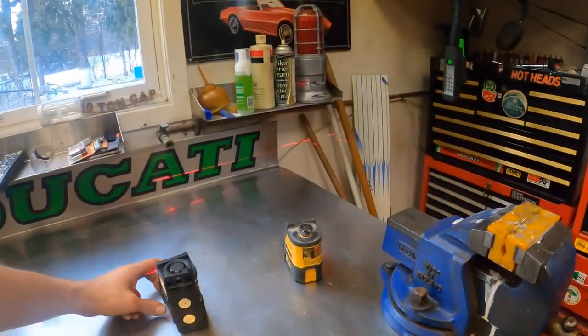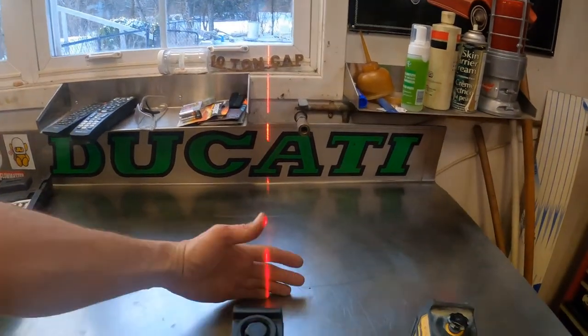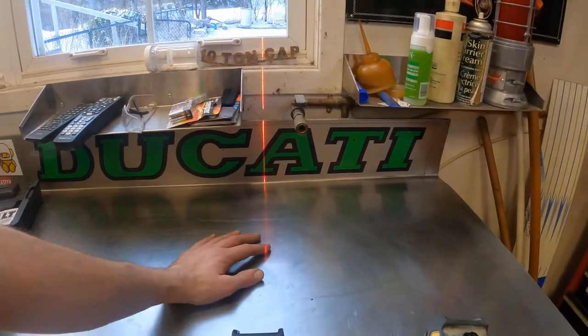All right, so the steering box is in the truck, pitman arms hooked up, the lines are all done and everything. So now I gotta finalize everything. I'll be doing an alignment, basically the string line method, but instead of using strings, I'm gonna be using these two laser levels here. And so just using them instead of the strings.